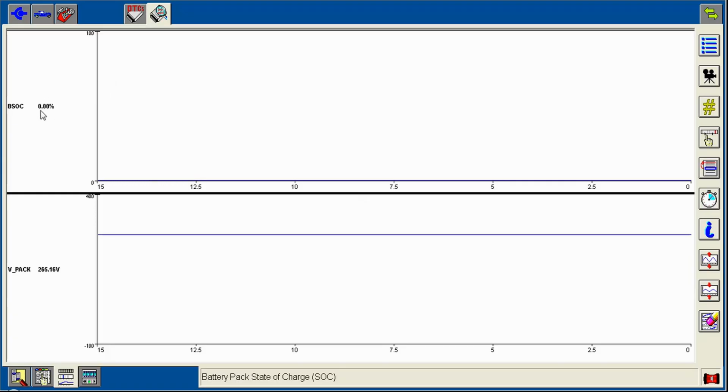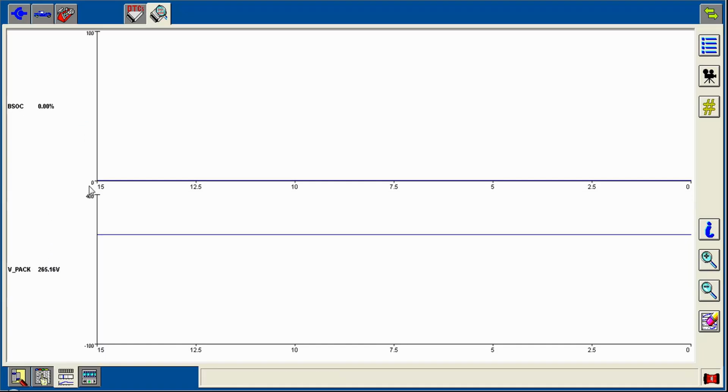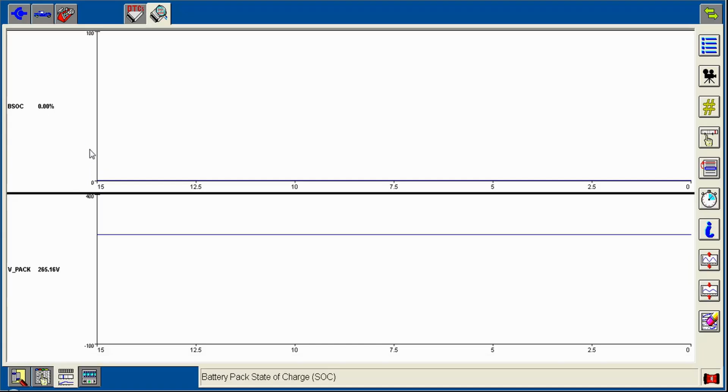So what we're going to do, we have a jump pack on there, go through a couple cycles of charging with the internal jump start module that the 05 to 2008 have. So let's go ahead and do that, and we'll come back and look at this battery state of charge and voltage and see if it starts then. Just go from there. Gotta have this thing charged though.